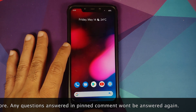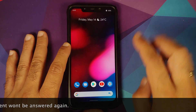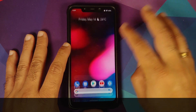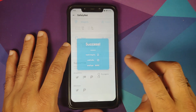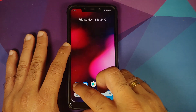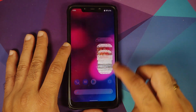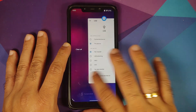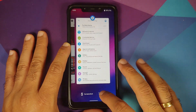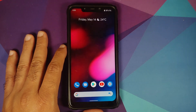The prerequisites for this video: you need to have an unlocked bootloader and TWRP recovery installed — we have separate videos for both, linked in the description. Make sure your battery is charged at least 50 to 60 percent — do not do this if your battery is at 20 or 30 percent. Also make sure you have a backup of all your pictures, videos, and anything important, because if we run into any boot loops or encryption issues, you will have to perform a format data from TWRP and lose everything.